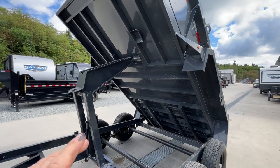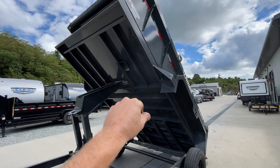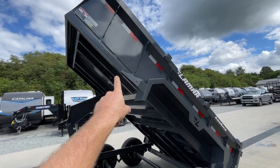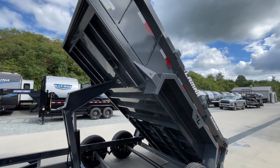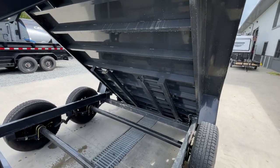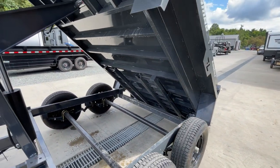Another thing that's a little different depending on the manufacturer: sometimes you won't see a bed frame. This has a four-inch channel bed frame. Sometimes on six-wides in the industry they'll take the sidewall down past the floor and extend it in, where the sidewall holds your floor cross members in place. This has a separate structural frame. Cross members on this are three-inch channel. And of course you've got your undermount ramps with the hook ends.